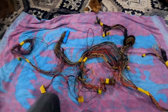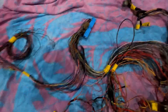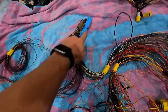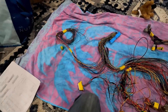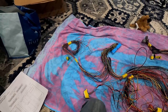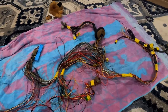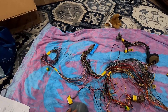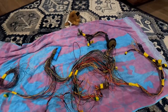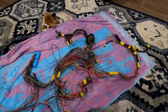So it's really not a whole lot left on this, but it's nice to trim it all down — it was a massive jumbled mess. We were able to cut off a lot of the useless stuff. What we're going to do now is go through the pins that are left over, go one by one to see where they end up on the ECU, then label them on their ends and cut short the ones we don't need. It's much skinnier than we started — took about three hours to trim it all down. Weight is the enemy when we work on a big old bus.